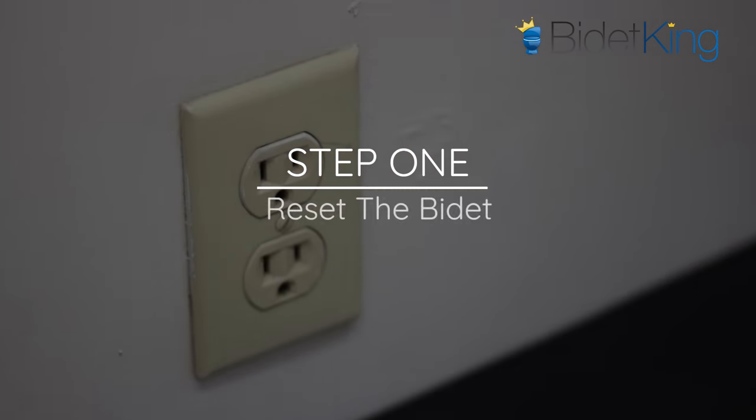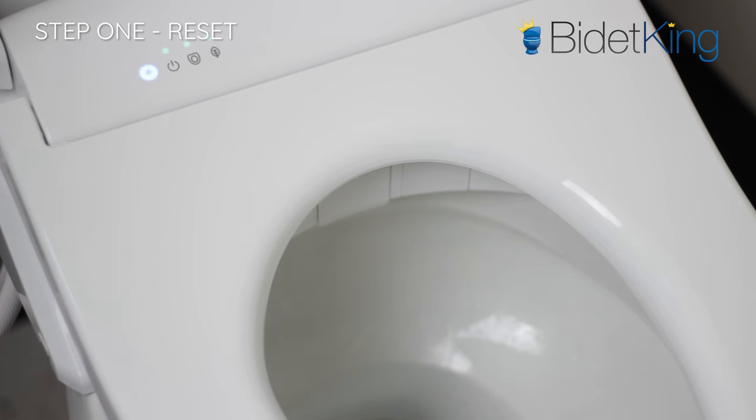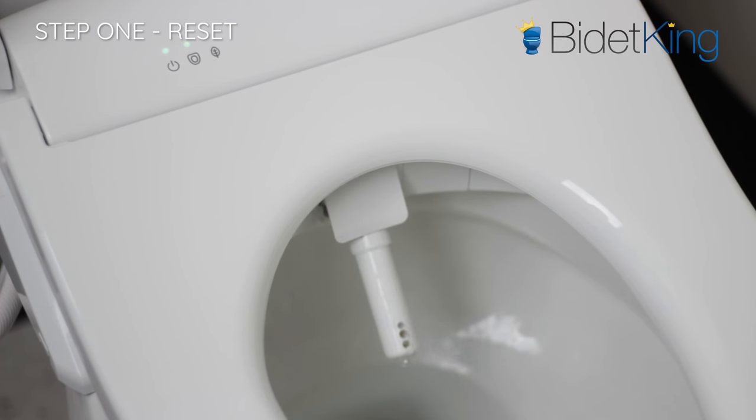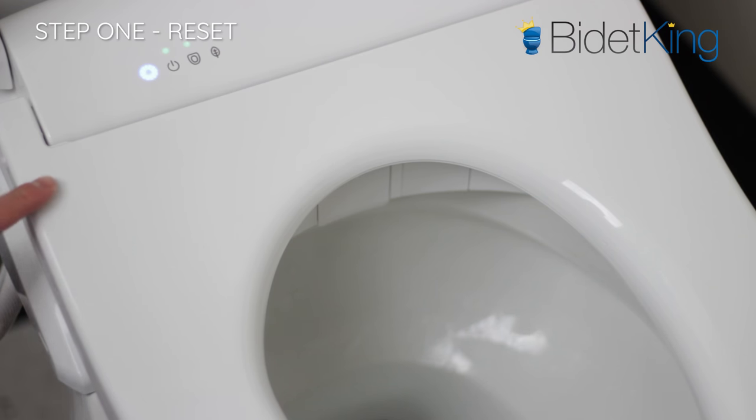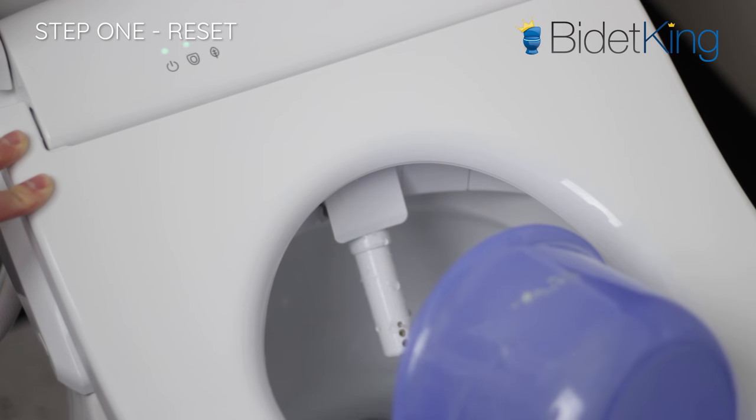Step 1. Unplug the bidet seat for 30 seconds and then replug. The first thing we want to start with is a hard reset. Unplugging the bidet seat for about 30 seconds and then replugging will restart the unit, including the internal mechanisms. Similar to a computer, a simple reset will sometimes solve small issues with bidet seats where components may have become out of sync over time. If a hard reset solves your issue, great! If not, then proceed to step 2.